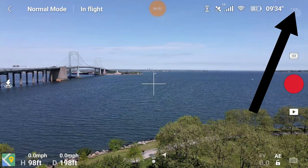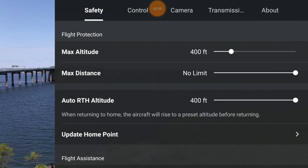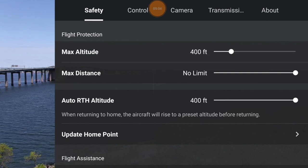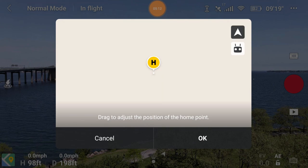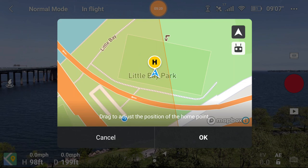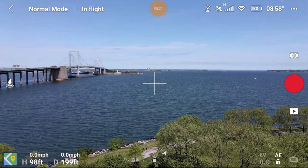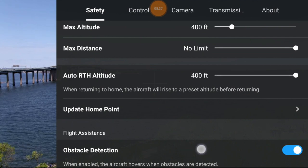My signal is strong. When you tap the three dots at the extreme right, that takes you into the main control menu. First and foremost - safety. You'll find your maximum altitude, maximum distance, and return to home altitude which we already set. You can update your home point by pressing there, selecting the point, tapping OK. I'll hit cancel - I'm fine with my home point. If you hit the little controller icon, you can update the home point to the controller's location.